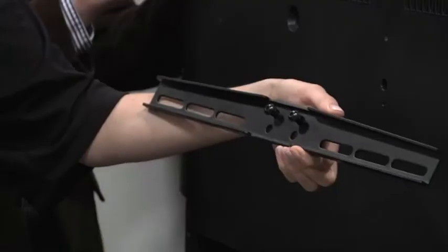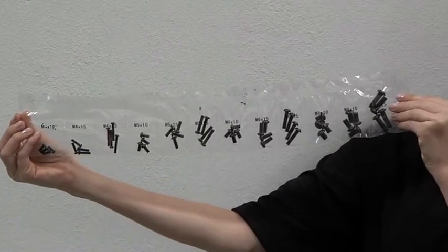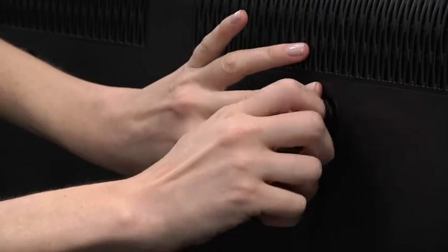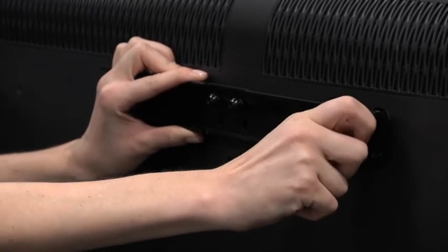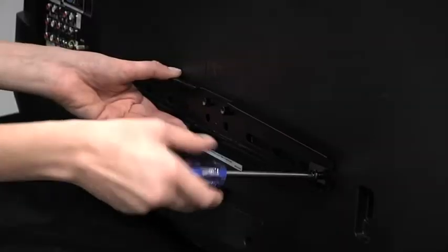The Allen bolt should be on the top of the bracket. Place the bottom bracket toward the bottom of your TV with the straight edge oriented towards the bottom. The Allen bolts should be on the top of the bracket. Remove the Allen bolts from the lower bracket — you'll put them back when you attach the TV to the pivot arm. Twelve sets of screws of different sizes are included with your mount. Match the screws to the holes in the back of your flat panel TV to select the correct set. Thread a screw by hand into one of the inserts to ensure it is the correct choice. Thread the screws through the rectangular washers and the mounting bracket holes into the four TV inserts. Do the same for the lower bracket. With a Phillips screwdriver, tighten the screws so the mounting brackets are securely attached to the TV. Be careful not to over-tighten. Check the level with the supplied mini bubble level.